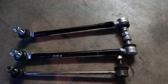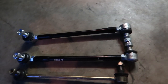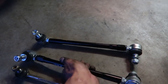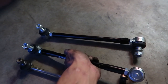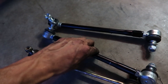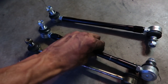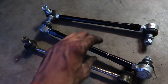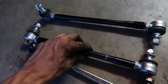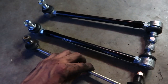I'm going to put them in at max short, throw the wheels on, jump on the car again, and then reach up under the car and make sure this middle piece will move freely — you don't want any tension on it. As you turn it one way it extends; one end is reverse threaded. The front should be a lot easier than the rear, assuming there won't be stupid tension on them because of them being longer. I don't really know how that works so we're going to learn together.